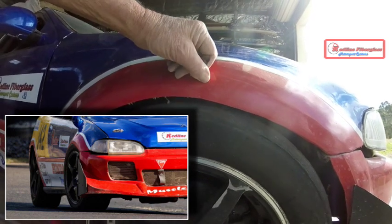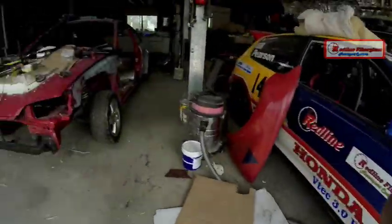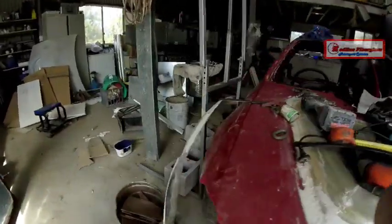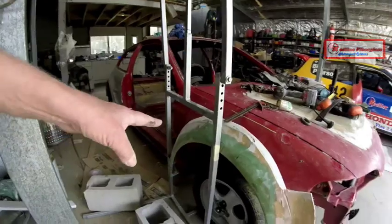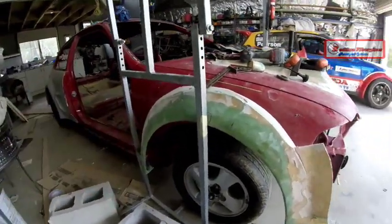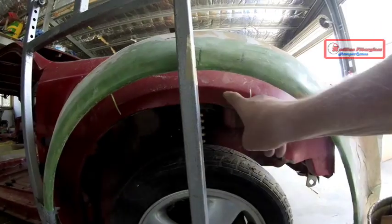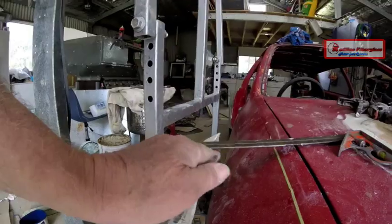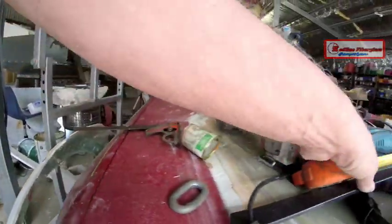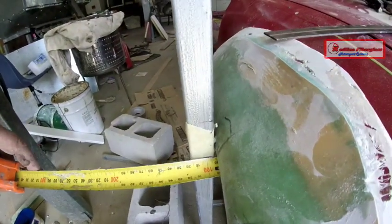So I want to raise this point up. That's my sculpting starting point — what I've done is positioned a flare I used for moulding the rear guard overs where I want it to be. It's about 25mm higher but it follows the radius of the factory guard's curve, and you can see that's up as high as it can go. You can also see it's a whisker under that 100mm max, about 95mm.